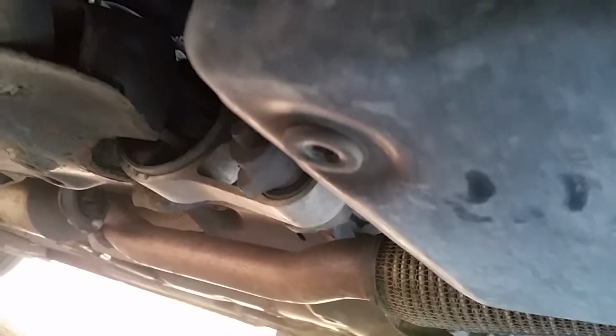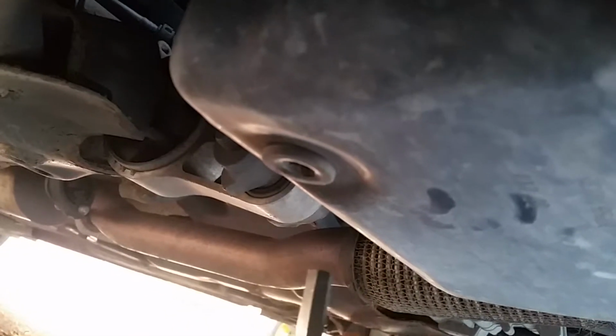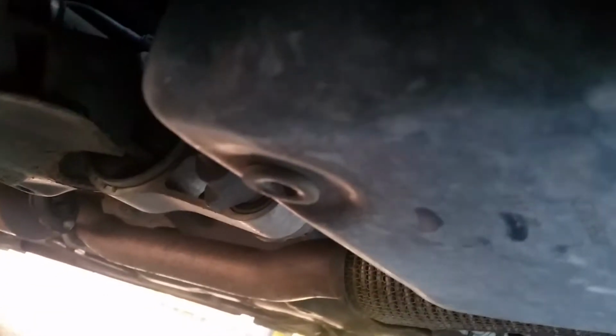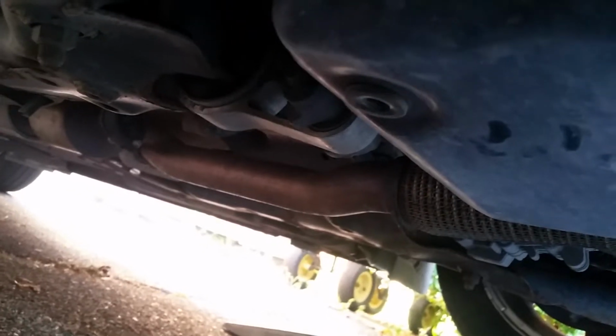Okay, to drain the oil, you see that it doesn't use a nut. It actually uses a hex. What I'm using is a 5/16, but I'm guessing that's actually metric. So we'll convert 5/16 to metric around. And obviously I don't have a socket set with hexes on it, so I had to use this and an extension, and basically to give me the leverage, I put the extension on the end just to give me leverage to break the seal. So let's go ahead and drain the oil.